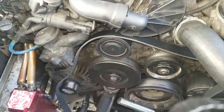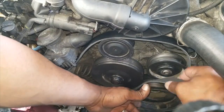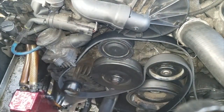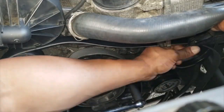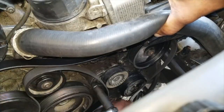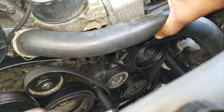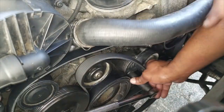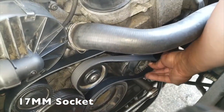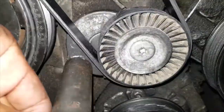I'm quickly showing you how to change the serpentine belt. For a more detailed video, it's down in the description and also up in the top right section of the screen. Basically, there is a layout that you follow to route your serpentine belt. You put your 17mm socket on the tensioner to release the tension, then you put your belt on. Detailed video in the description and above.